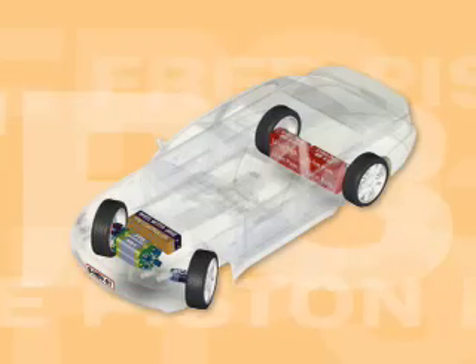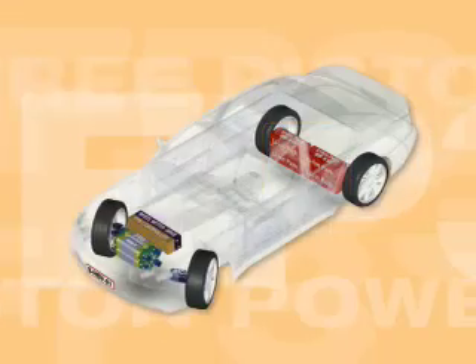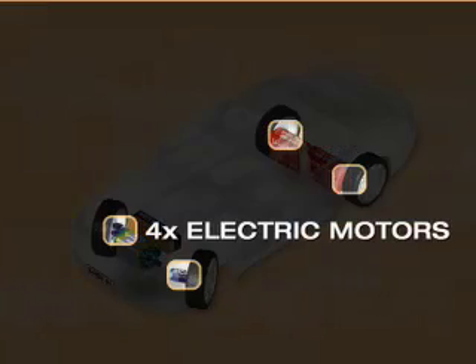The FP3 is designed to be used in hybrid electric vehicles. The main advantage of hybrid electric vehicles is that they have an electrical energy storage source in battery form. The FP3 runs on demand, so when you're driving around, it's basically a combination of the FP3 — the internal combustion engine cum generator — a set of lithium-ion batteries, and four electric motors. This means that we don't waste energy when we brake; we merely recover it from the wheels and put it into the batteries.